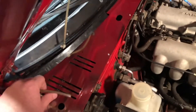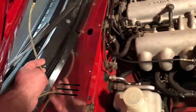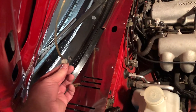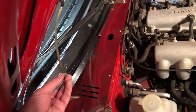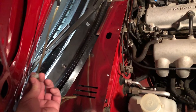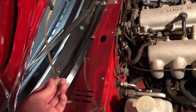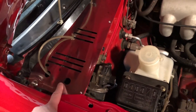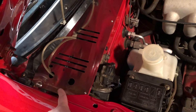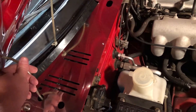Another thing I had to do was disconnect the washer fluid tubing from the hood connector. This is all original and kind of old, and I couldn't get it to separate, so I had to snip that. I think I'm actually going to have to get a new connector here to snap it back in, because I can't get this old tubing to separate from this old clip. So I'll order a new one and get that reconnected. The panel has a couple of holes — there are no instructions, so they don't say how you're supposed to route that through or even what the holes are for. I just picked one and that's where I'm going to run it through.